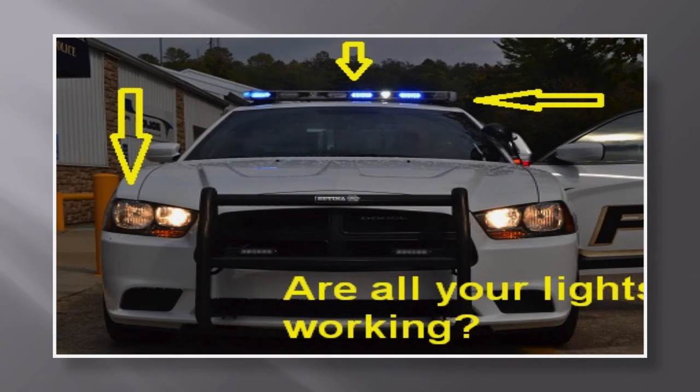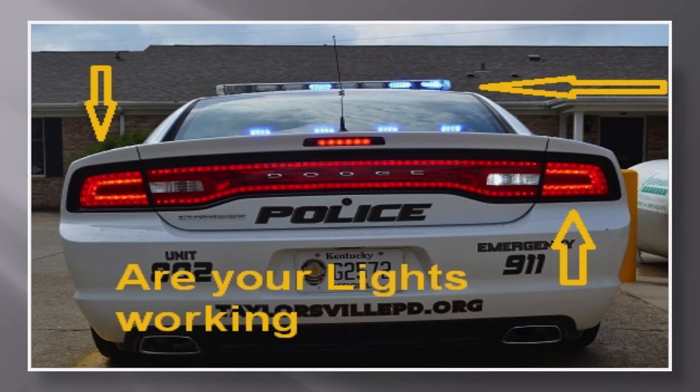When you get in your car and begin to do your vehicle inspection, are all your lights working? If there's a light on your police car, it needs to be working. You certainly wouldn't want to drive around with one headlight out and then be subsequently stopping people and issuing citations for one headlamp. So take the time to turn all the lights on your vehicle on, walk around the car, and make sure they're all working. It's also important to keep these lamps clean — when you wash your windshield, wash your headlamp covers and your tail lamp covers. It may save your life.